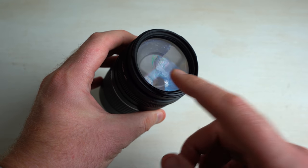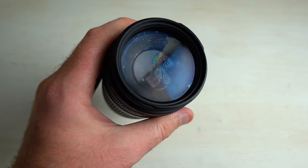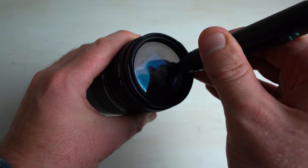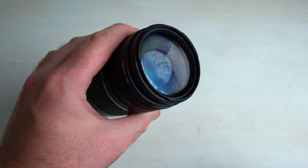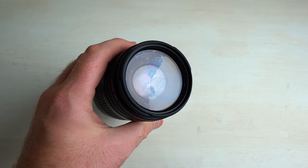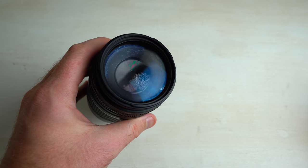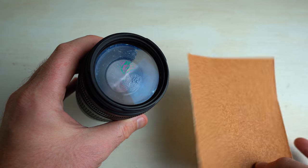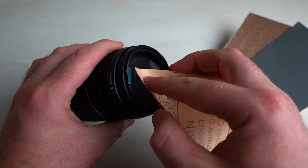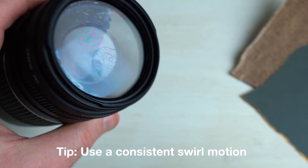Let's move forward and check the front lens element. We'll give it a nice wipe just to make sure it's clean, and actually if we look closely here there's just a little bit of a ding in there. What I want to do is get rid of that scratch, and we use the lens pen for this one. We've got it clean and nice, really trying to buff out that little scratch. You can see that helped maybe a little bit, but not a hundred percent. If we can't get rid of that, we kind of have to make it consistent across the whole lens — so I like to take a little bit of sandpaper and kind of choose which one is best for you. Just take that sandpaper, find that little scratch, and just try to buff it out a little bit.